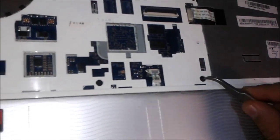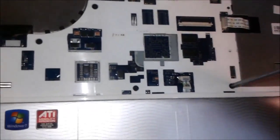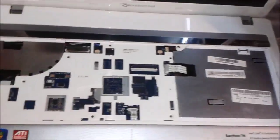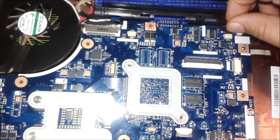There are some screws here — two, three, four, five, six — we are going to remove them all. That's all six screws removed from here. Now to pull up the top cover, always go to the CD drive side — there is always an edge there. Pull it a bit and the cover comes off. You can see the cover is pulled up and removed — easy way to take out the top cover.